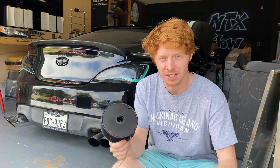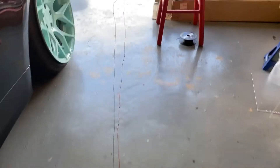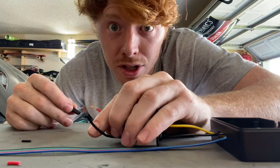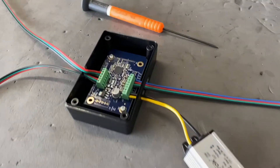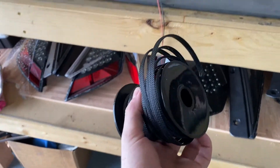The way I figure out how much power wire I need is a little ridiculous — I kind of just gauge it from the outside of the car. Now we have the power and ground wire. You could put this directly on the module, but I like to add the converter right here next to the module. Always remember heat shrink. We've got the converter on there and the power wires on there. The converter is only because I'm using 5 volt addressables and not 12 volt. Now this is pretty much completely wired up.